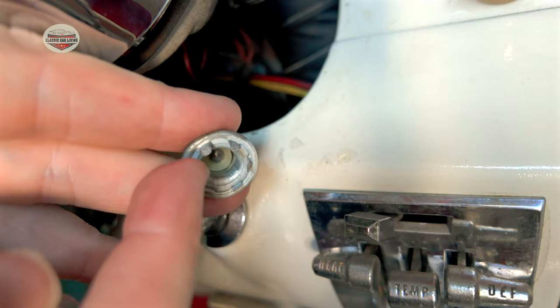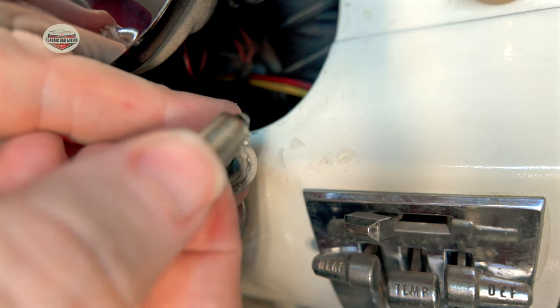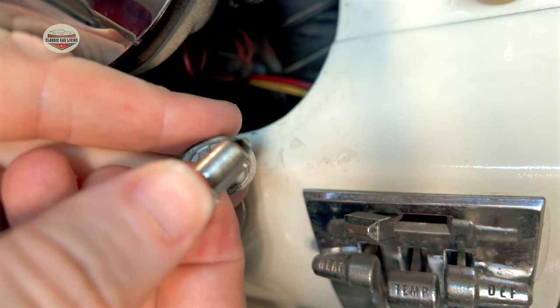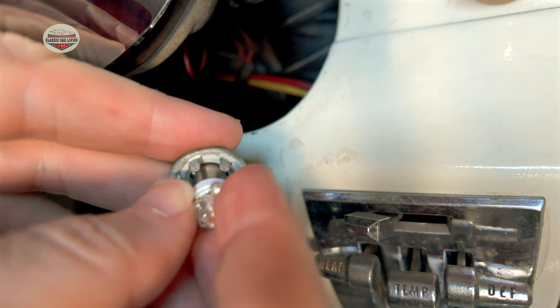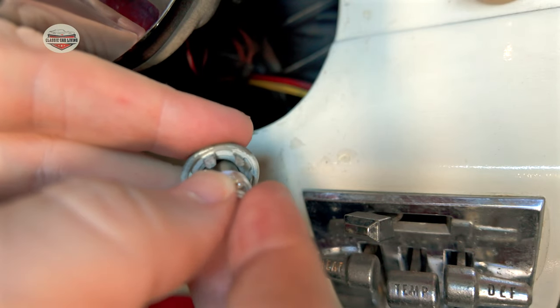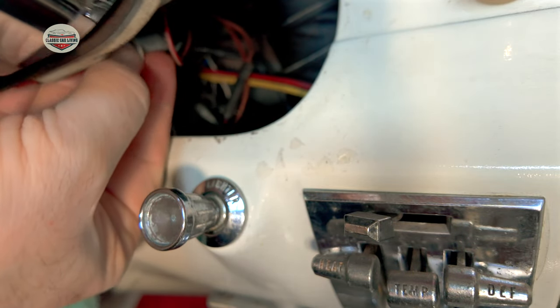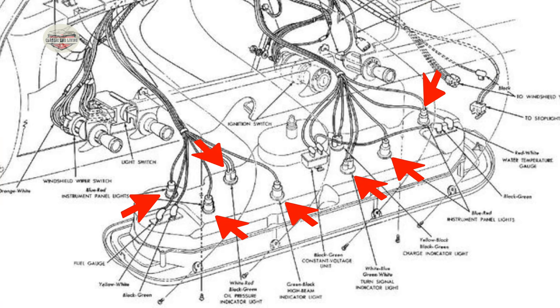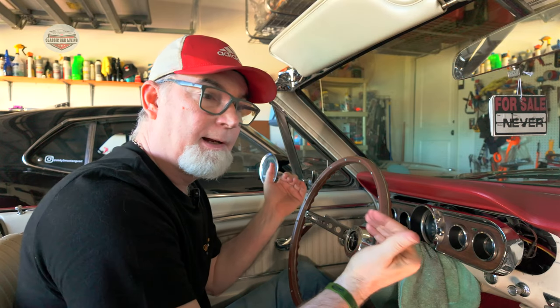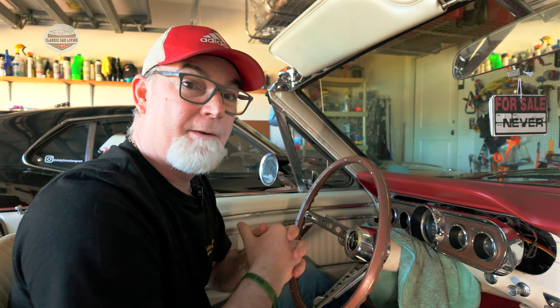Now if you look in there you can see there's a little notch here and there. So when you grab your next light bulb — the Scott Drake LEDs — there are the little notches. Line them up, do a little push and a quarter turn — that's it. Very simple: push, quarter turn, then put them back in. Now look at the schematics, see where all the light bulbs are, and just do the same thing: pop them out, push-in quarter-turn out, replace them, click them back in.